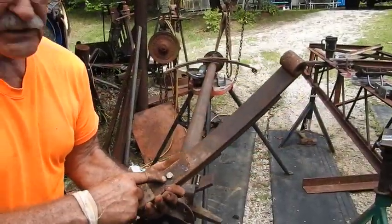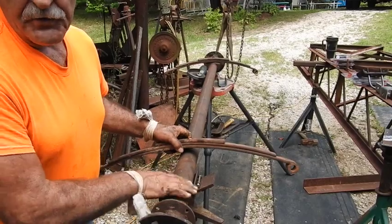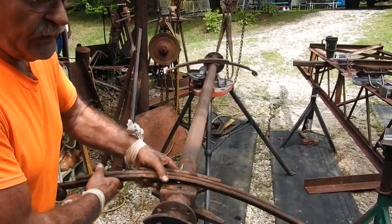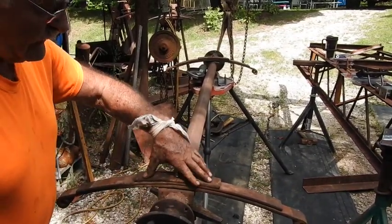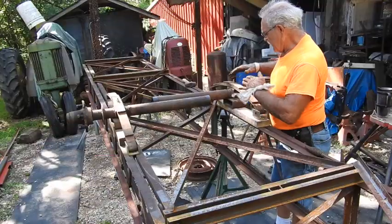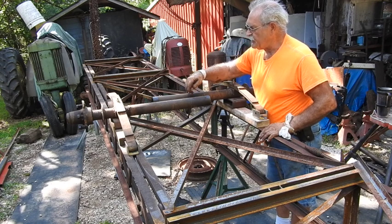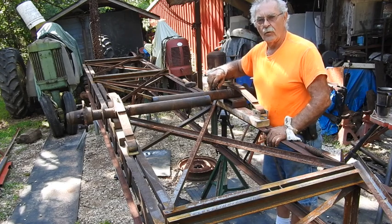Whenever I ground this head down just a little bit, it's got to be round in order to set down in there. This little thing right here is called the spring perch — that's welded to the axle in a fixed position. This actually sits right on top of there. That hole in the spring perch with the mounting pin on the springs keeps that from slipping or sliding out from under. That combined with the plate and the U-bolts holds everything in place. I'm just trying to square the springs and axles up with the frame so that I can mark center line down through here to cut these off and re-weld.